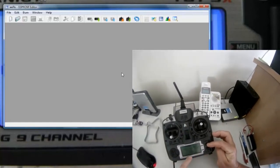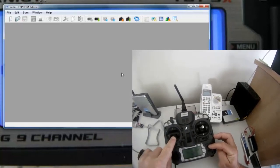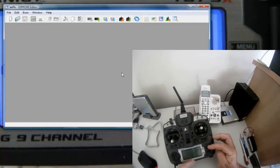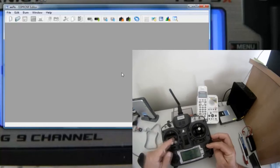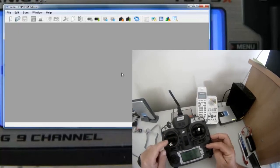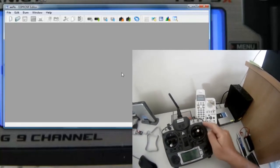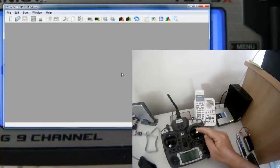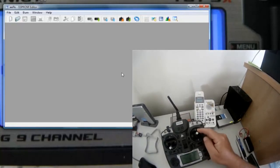I see here on the left stick, the little square is telling me that the stick thinks it's in the far right hand corner, which is way over here, but it's not. See, it's dead center from there on, and the other stick is the complete opposite. It thinks that this is far over there, and when I move it back it always keeps going back to there.